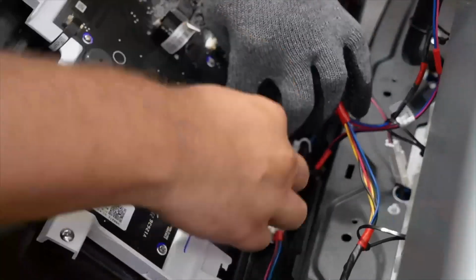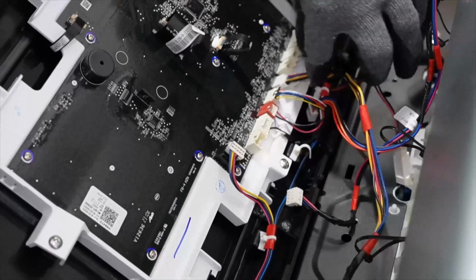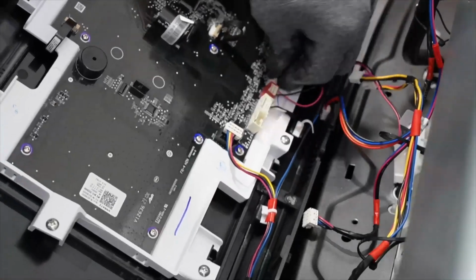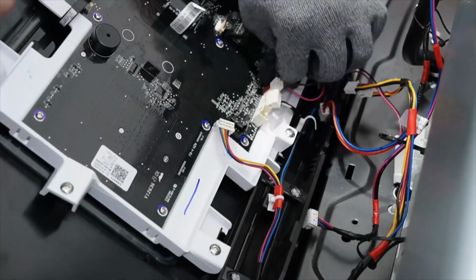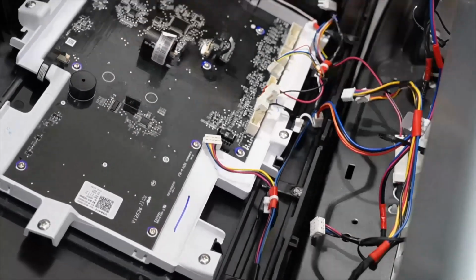Make sure to be very delicate with the wires as you remove them. Also note the push mount wire ties on the interface. Depending on your needs, you're probably going to have to use a wire cutter to remove some or most of these that are either inside the console itself or on the washing machine heat shield as well. Just be very careful not to damage these wires. When you use the wire cutters, remove only the plastic cable ties themselves.